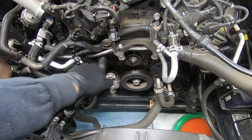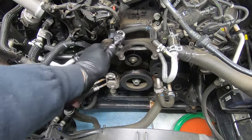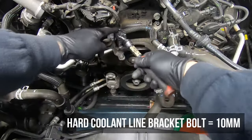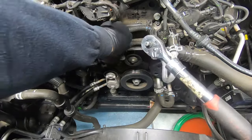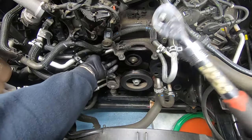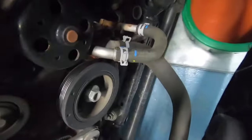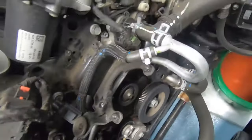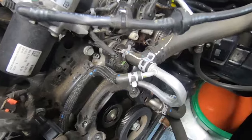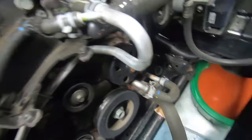Belt is off. There are a few more obstructions to remove before we can fully take the pump off. There's this coolant line running to the thermostat housing — we're going to back off the 10mm on this bracket that's holding the line to it. Got it out by hand. That gives us some play in that coolant line, but still not enough to get to the water pump bolts. So I'm going to move the drain pan over, then disconnect the two coolant lines going to the water pump and also this cooling line here, so we can pull it back and gain access.